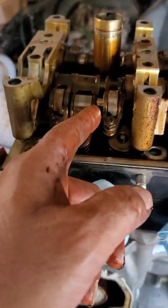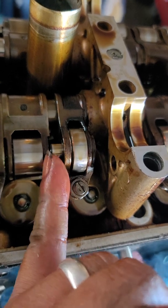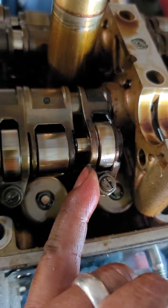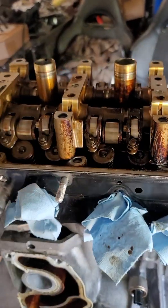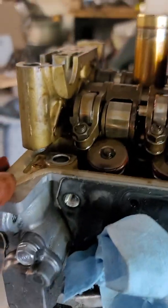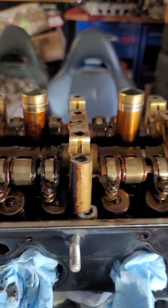Part two already — got the cams off. Now you have to be really careful with these pins right here. Try not to lose them because some of them are spring loaded, like this one here. Once you get the top cam cap off, you can remove the camshafts. Because these are already gapped loose, I'm going to carefully run a zip tie underneath them and zip tie them shut so they're compressed again.